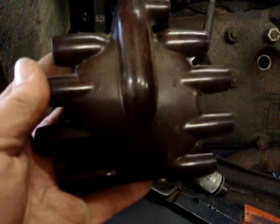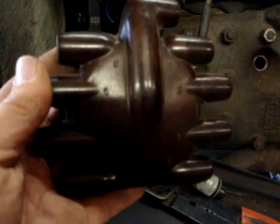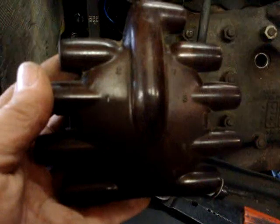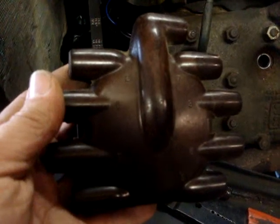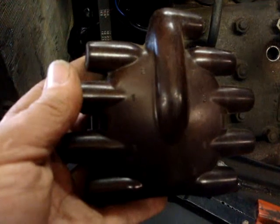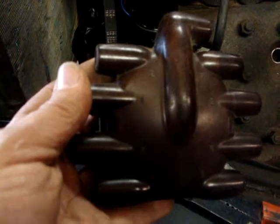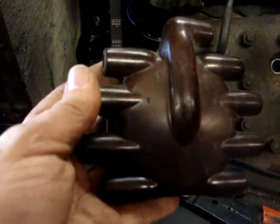That cap down there is going to be wired the same, so that tells me that right now, as this is assembled up, it is going to spark on the number one cylinder. I hope that might be helpful for anybody. That's what I've just done to work out if I'm right or 180 degrees out — I had that distributor all the way apart and put it back together. If you take it right the way apart, you can put it back together wrong, so I just wanted to make sure it was going to be right. Cheers for now, bye.